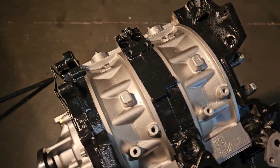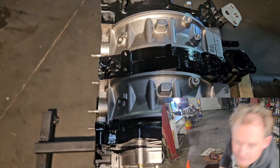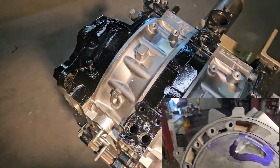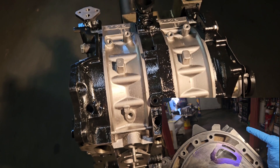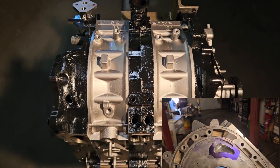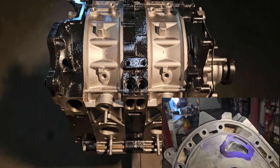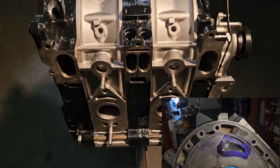Used block. We cleaned up the porting, resurfaced some stuff, lightweight rotors, balancing, all new bearings, spec'd everything out to Mazda speed race tolerances, polished the shaft, and generally made it so it's a little brap monster.